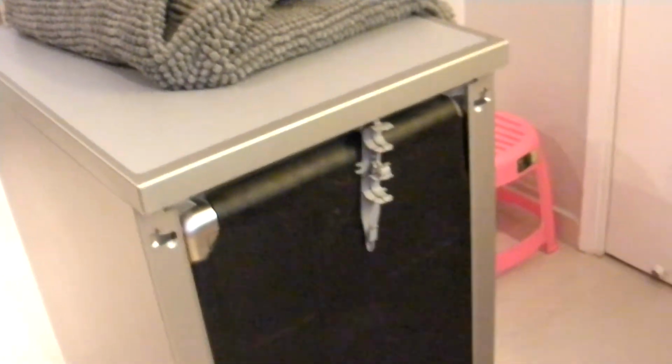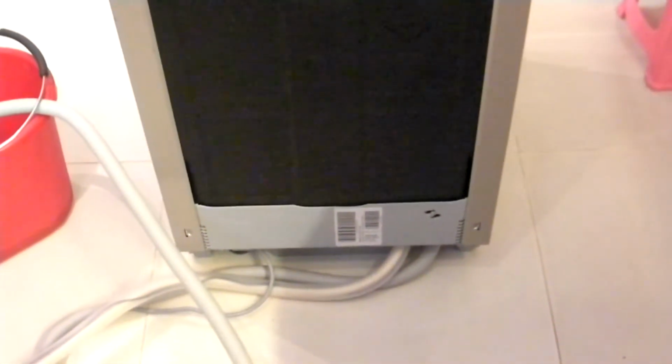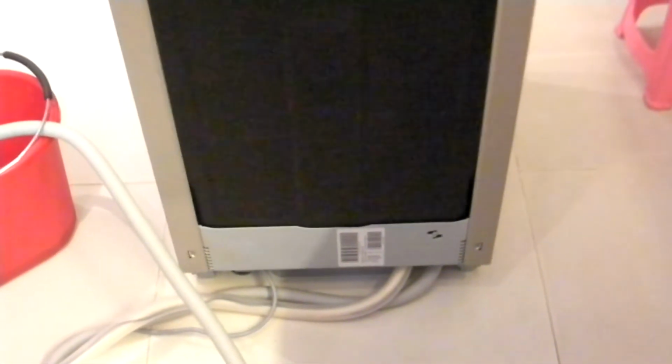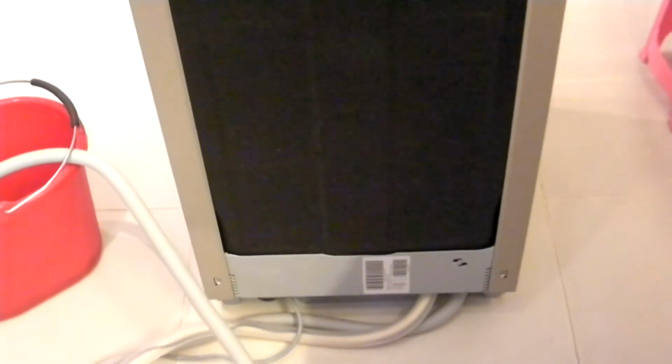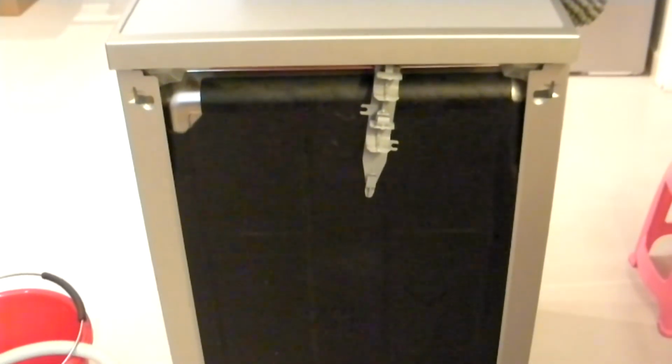And the way to accomplish that is to be cutting holes in the bottom so as to get that in there, or the side, but the top is the absolute worst place to put it. So for those of you installing one of these dishwashers, you have a choice. You either do it in the bottom, which is ideal, and then you create your high loop after you've gone somewhere where you can do such a thing, or you go around the middle, and that might fall underneath that lid if you push a little bit. It'll squish the hoses, but they'll survive that, no problem.